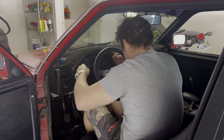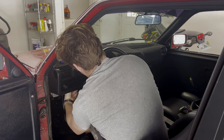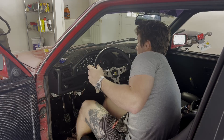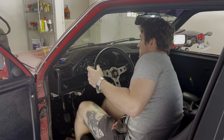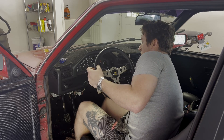I've done all the usual stuff — tried to sort them out, tried to really identify what's going on. Pulled fuses, changed bulbs, checked grounds, made sure that the wires are getting voltage, and it's just a poor pin fit. Also the fuel gauge sometimes works, and sometimes just tells you a completely random fuel level. The temp gauge you have to tap to make it work.